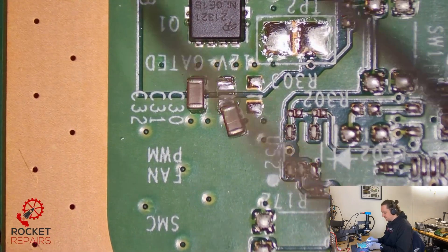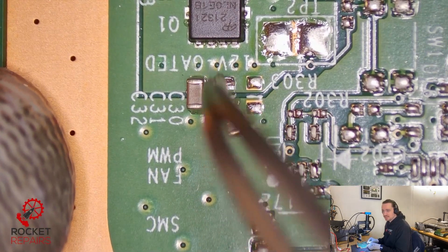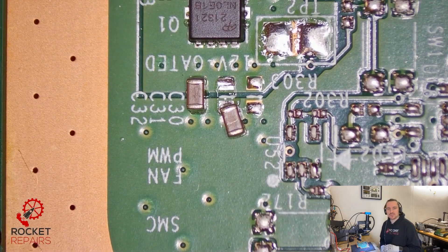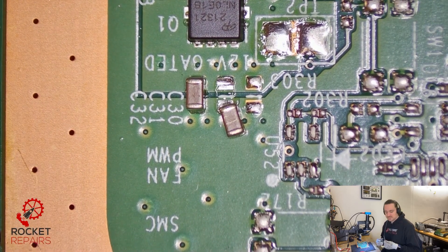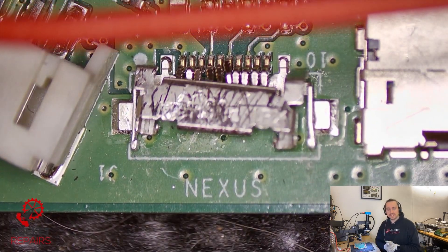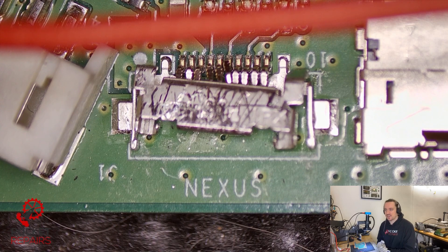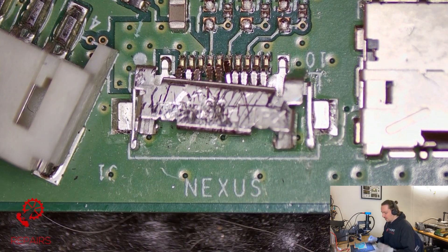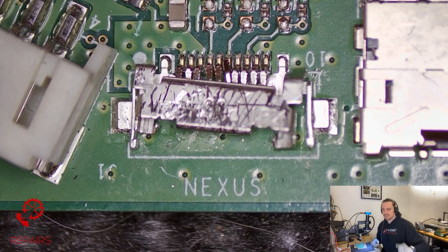What's good is that I don't think we actually need to replace this cap purely because we have one in circuit right here. I will test it to make sure the console now turns on — we can just use the Xbox controller. We've also got some Nexus connectors on order and they're not here until the weekend. Once they come I can get this replaced and we should have a fully working Xbox Series X. I'll continue this video when we have the Nexus connector in stock.